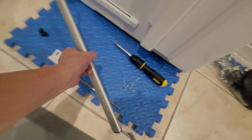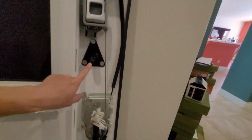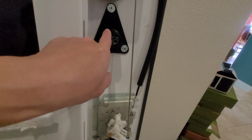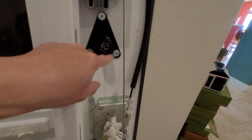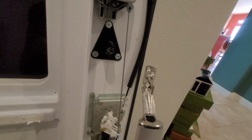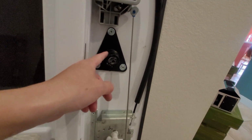Let's look at this handle. Sometimes this handle can become loose. So when you take this panel off, this panel usually sits on this side of the door. That handle just gets screwed onto these little plastic pieces here. I discovered a couple of extra holes here, and it's just plastic on here, and it's really easy to strip out. So whoever the original installer was, if they tighten it too tight, it strips this plastic. So if yours is the case, you either need to make new holes. If you see these, it has 4 places you can put a hole in. Or in my case, I've even taken this piece off here and put a piece of backing. This is just a hollow cylinder, and put a piece of backing in there.